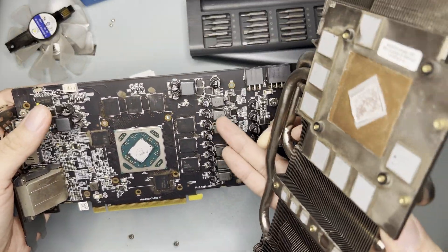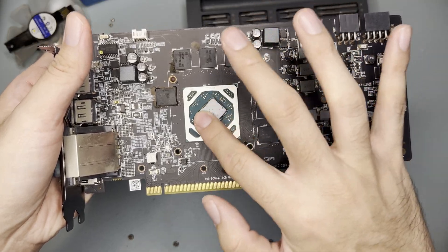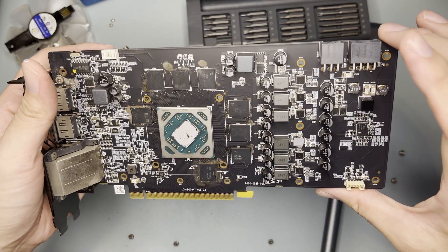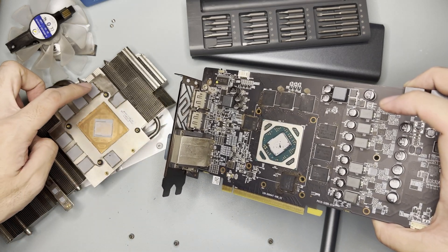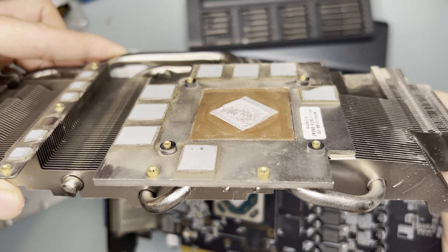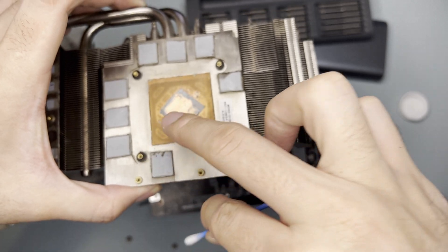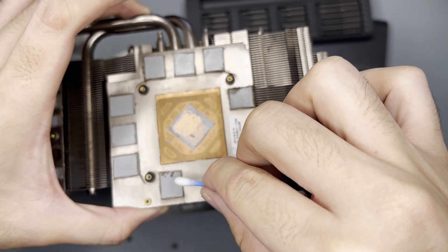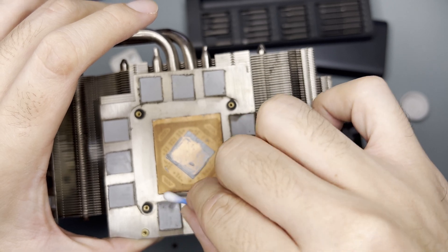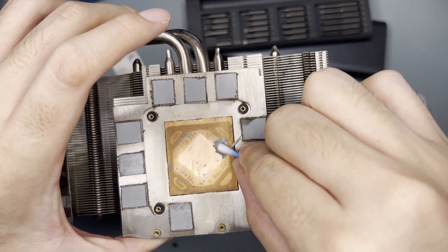The only cooling for those components is through the backplate. The thermal paste is also very dry — you can see how dry it is. This will likely just need to be repasted, and if you have thermal pads available you can replace those too. The thermal pad seems to be the thinnest available, around 0.5mm. The quality is still okay but best to replace them — that's probably why it was slower than expected in benchmarks.